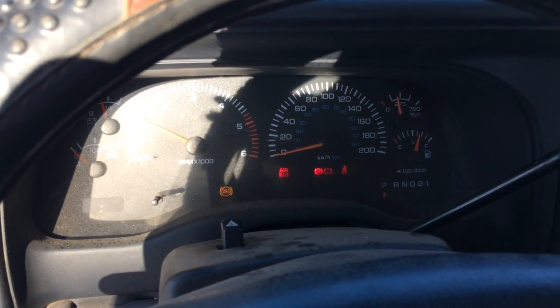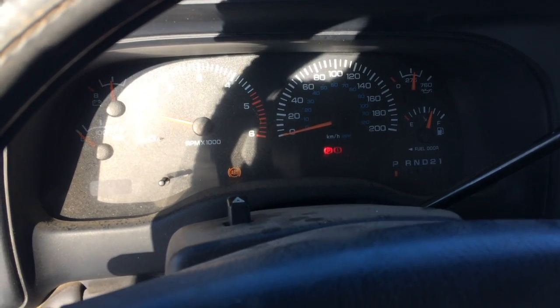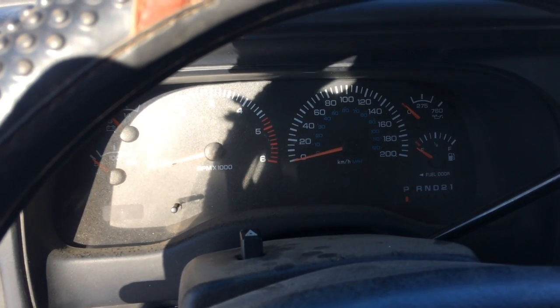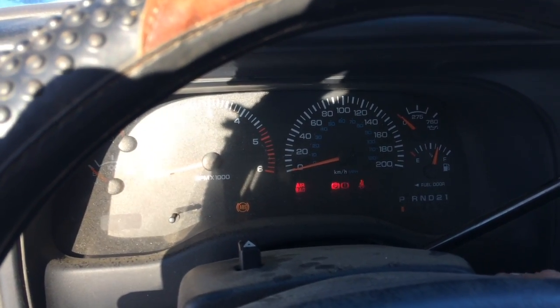You're going to want to check restarts. You're going to want to let the engine run for a while. Maybe let it run for a half hour. It has 3/4 of a tank of fuel in it, so I mean, let it run. Then shut it off and try a warm restart. This way you know what it needs during the process.